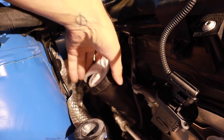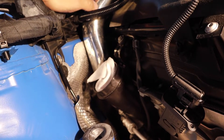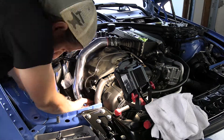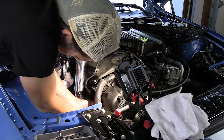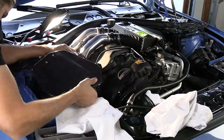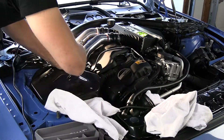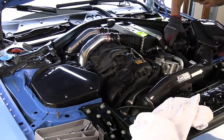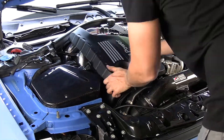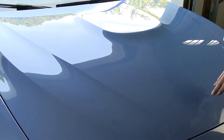It's really helpful to remove the intake pipe that sits between the charge pipes — just a 10mm socket to undo that one bolt, then it pulls straight up. Now that the rear charge pipe is set up and clamped down, do the front charge pipe and get that situated. Put the intake tube back on so the intake boxes can go back in. Then reassemble the coolant tank on the driver's side, get the driver's side air box back in, get everything tightened up, put the engine cover, brace, and plastic shrouds back on — and we're good to go.